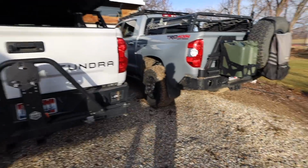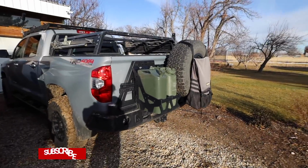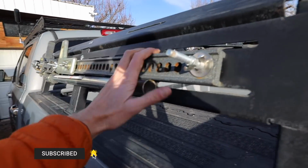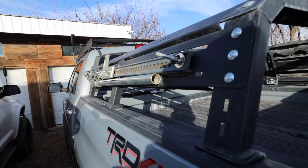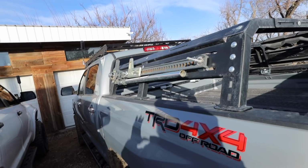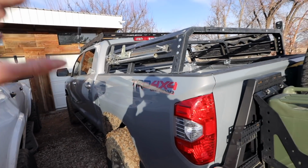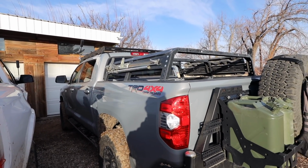As far as safety, as far as getting a 37 on and off your truck when you break down, I have used the high lift jacks in the past. It's probably the least safe option if you don't know what you're doing. If you know what you're doing and you get a wide base plate for it, they work fine. If you don't know what you're doing, you can have your truck tip over on you quite easily, and it can be very dangerous.